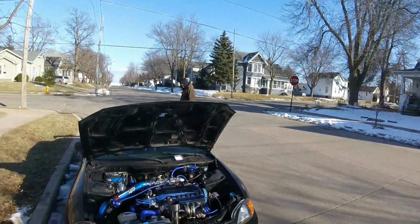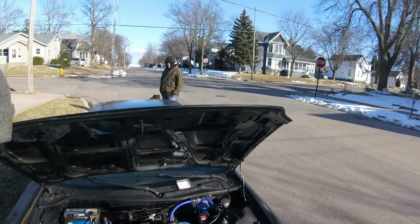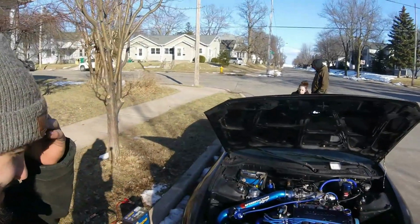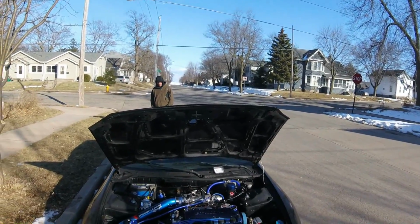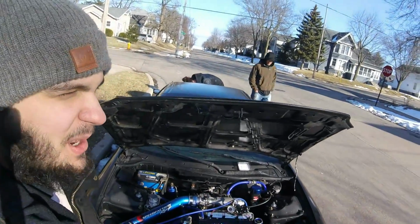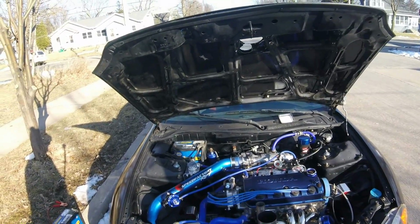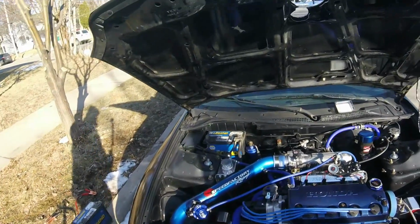Motor's a Z6, right? Yeah, Z6. It's got Eagle rods. Stock bore, or is it bored out? 76 mil, same as Michael's. He went 40 over on his too. I didn't want to go to the unsafe part. I wanted to keep it somewhat safe, because 76 is, I think, the max safe spot you can really go to on a single cam. My goal is to hit that 496 world record mark. I want to beat that non-sleeve record. Just one step at a time.